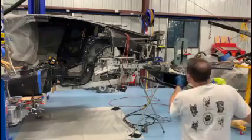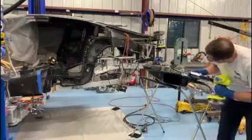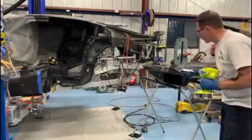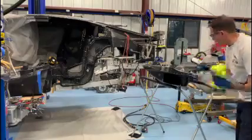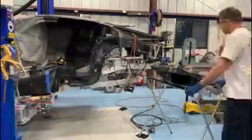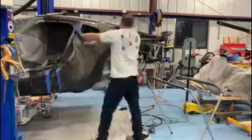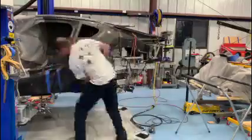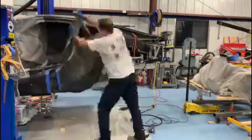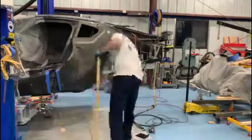Ultimately I'll add plates on the outside to bond the outside as well, which will sandwich that seam. I've been doing this on the seat pan in the back and the bulkhead, and it seems like it's going to work just fantastic. I dry fitted everything before and it fit like a champ, but now that I've got it all packed full of epoxy it's giving me a little bit of a problem — but nothing a little two-by-four can't help with. A little push and pull and a whack with the rubber mallet, and everything starts going into place.